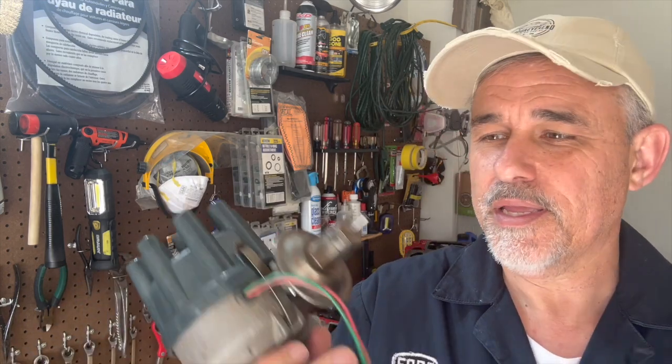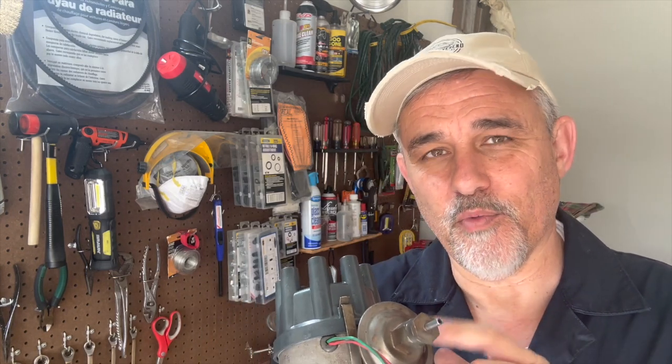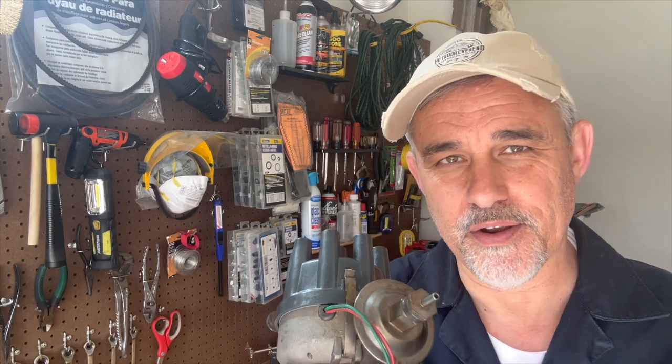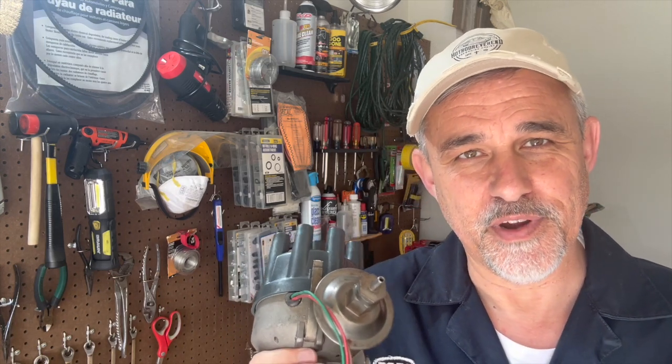There's a good way to do that and we're going to go through this process. You may be wondering what's the big deal here — why do I have to do this modification? Understand that with a 57 to 64 distributor, this will work with your Holley 94 or your Holley 4000. But if you don't change your vacuum signal, you're going to be sending way too much vacuum to this advance canister. You're going to have problems with detonation, issues with tuning, and all the rest of it. You want to make sure that you're getting ported vacuum like you have on most modern carburetors.